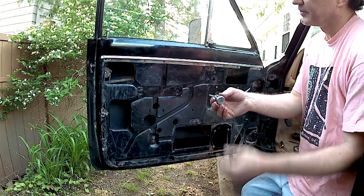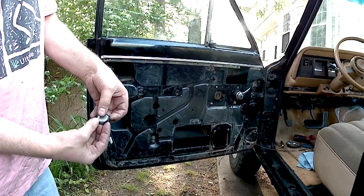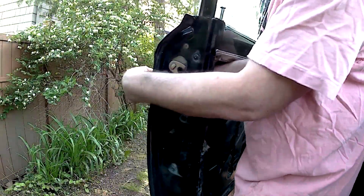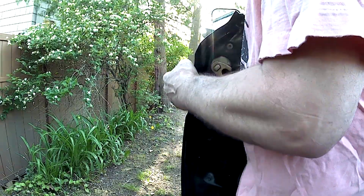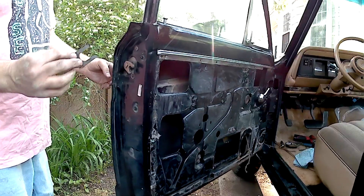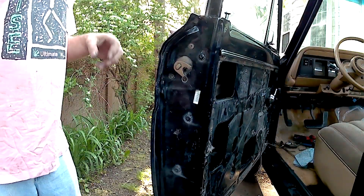Next, the lock cylinder with a fresh gasket. Lock cylinder fits into the gasket. Like the door handle, it should sit flush within the ring around the perimeter of it. There's a little square hole you have to get it to connect with — just the very tip of it engages that hole. It won't go in unless it's engaged. And remember, that lock slides in and holds it secure. If you ever have to replace it, just pull that out and your lock cylinder will just pull right out.